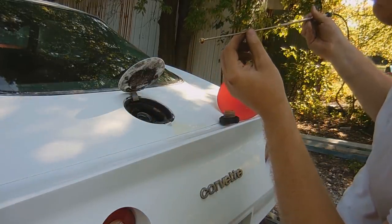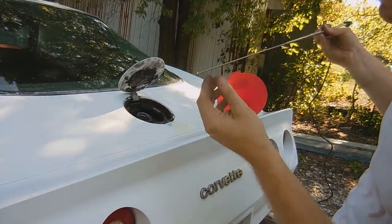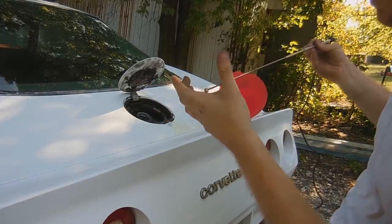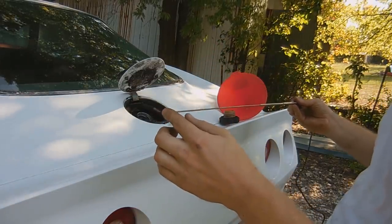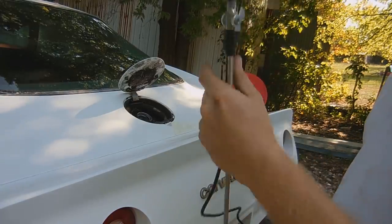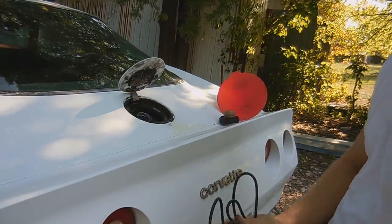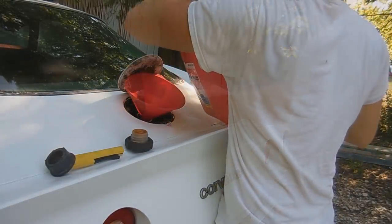I mean, I got one little drop, but that's it. None of the rest of this is wet at all, so there's no gas in it whatsoever. So before we change the fuel pump and rule that out as not pumping, let's give it some gas to pump and see what it will do. The bottle.